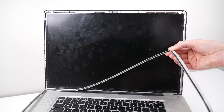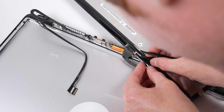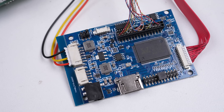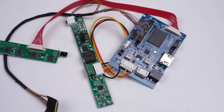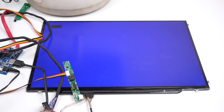Unfortunately the original display uses a totally different connector to that of our replacement, so we'll have to run a new cable up the arm. The MacBook screen will also need a controller to power it - I purchased one from AliExpress. Connecting the new controller to the MacBook screen, we can test that everything is working before we fit it inside the iMac.